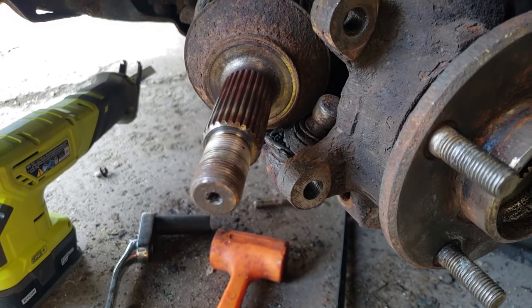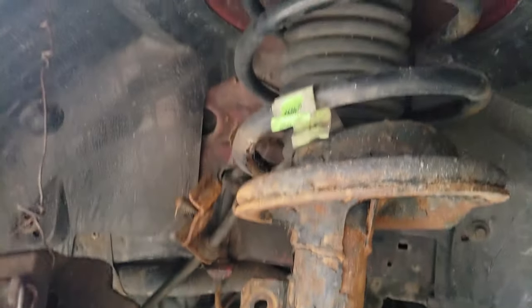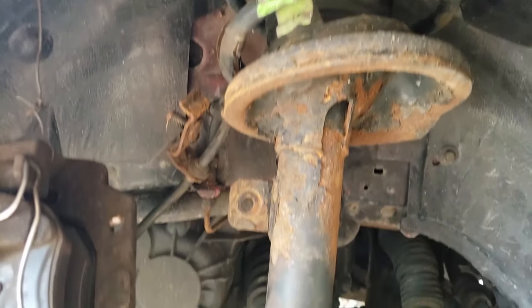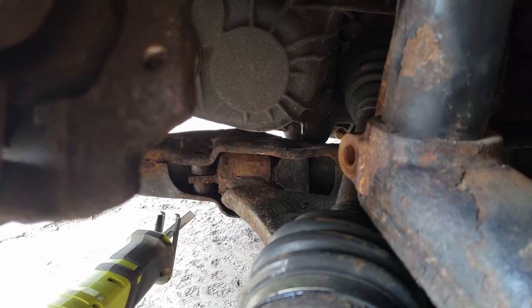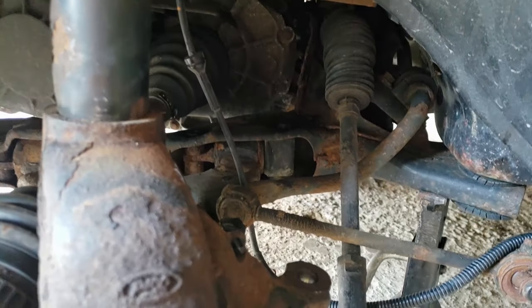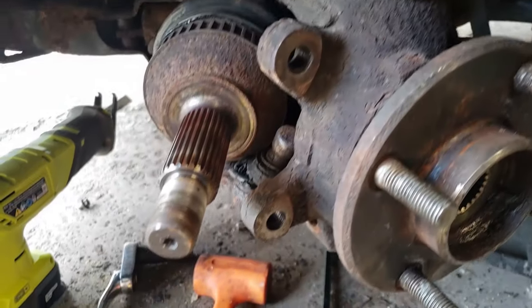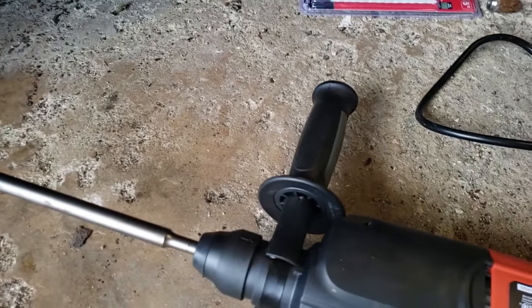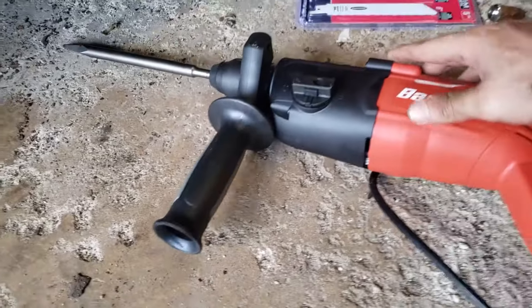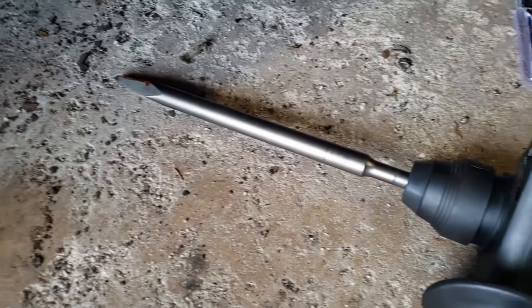As you can see, a little finagling and got it out. Now I'll be able to take the whole strut assembly out. I did cut out the two bolts — extremely painful. I have to do the other side to get the other control arm out. But here it is — rotary hammer. If you have a seized axle in a hub, you can see the bit there.